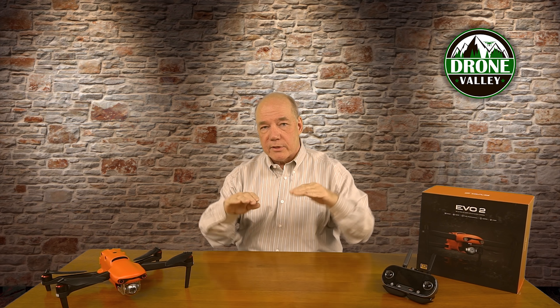The one-inch sensor is going to use the same firmware that's in the quad today, so you should be able to just pop it in, boot it up, and be ready to run. The one thing I'd recommend is doing a gimbal calibration after swapping any camera, because even though the mounting is rock solid, if it's in slightly off to one side you may get a tilted horizon. The calibration takes about 15 seconds, so don't worry about firmware — just do that gimbal calibration and you'll be all set.